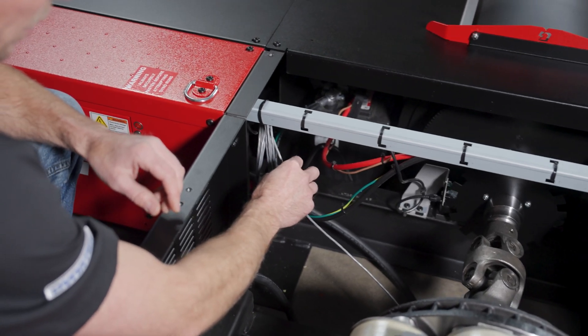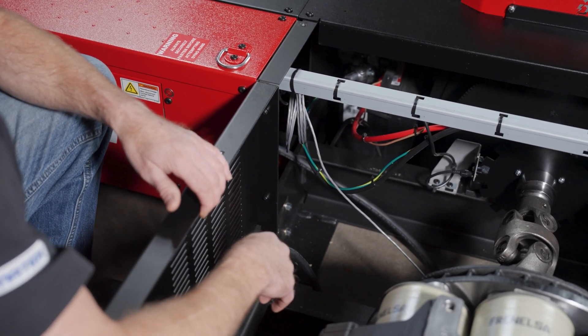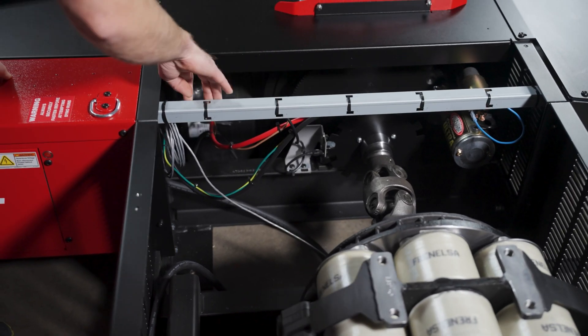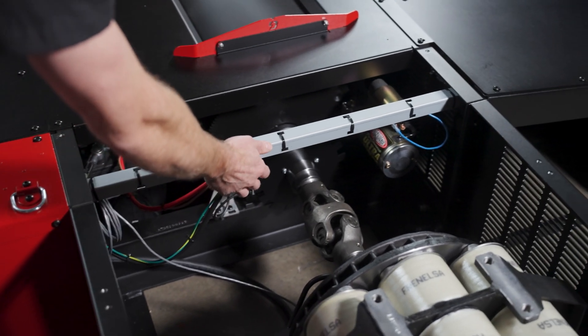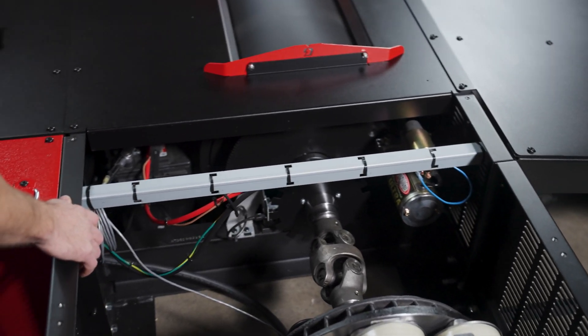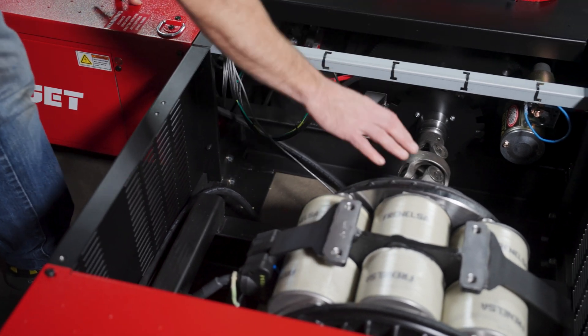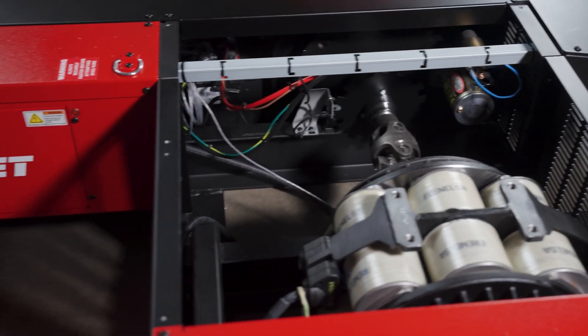The cords in the back are also critical to manage. Here is our infrared cable that aims at the side of the retarder disc to verify its operational temperature. Any cables run from the back to the front of the dyno should be well managed with zip ties in their proper locations, so none of the cords can get caught in the wheel or the retarder disc.